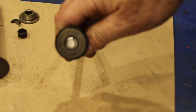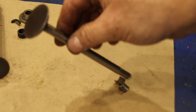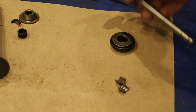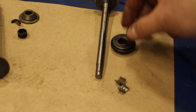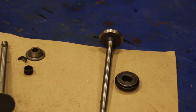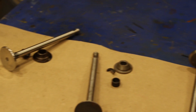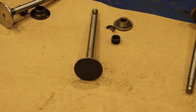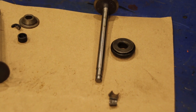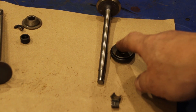The thing with Bertram's RMC-prefix engine is that both the intake and the exhaust had rotators on them — so intake valves and exhaust valves, different keepers, different valves. That's the kind of stuff where you open up an M38 engine and wonder what you have: valve configuration one is standard L-head; mid-range is where everything's different — the valve, cap, thin keepers, retainer; and then you get the f-head exhaust setup, which is essentially standard f-head stuff.